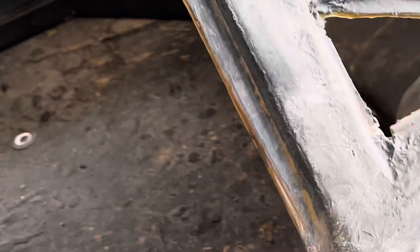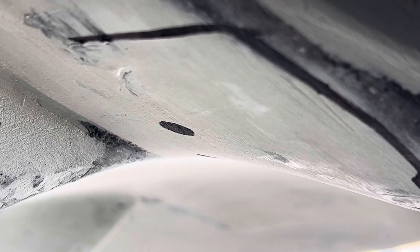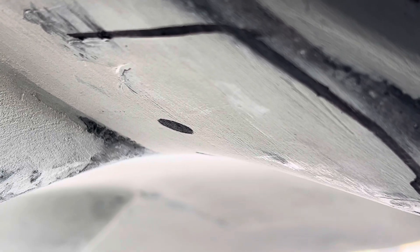My next step is going to be working on this right here — going up and then catching some metal in this corner up here for the hinge for the door. I actually set up my door and mocked it up on here already, and I was able to get a mark up here. I've got holes and everything for the OE hinge to mount through there, so I'll be drilling that through and coming on the inside here, right up in that pocket — putting a piece of metal in there.